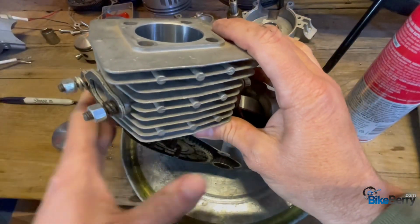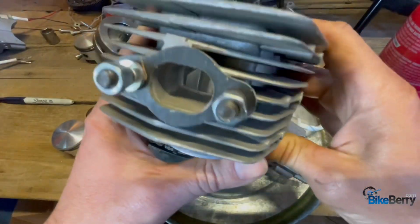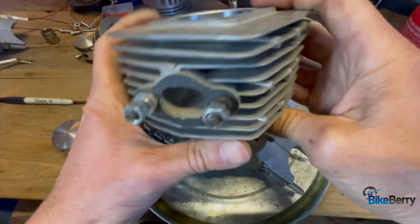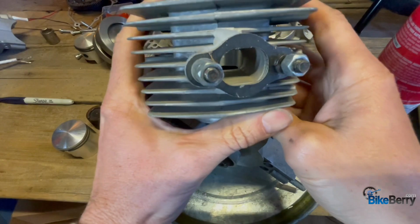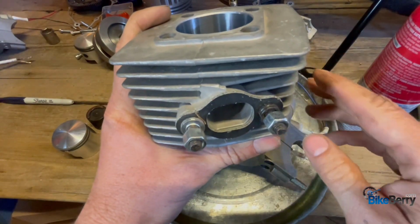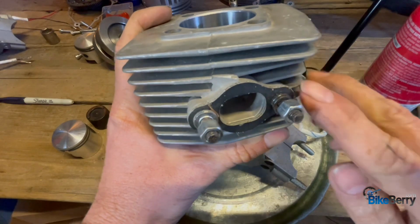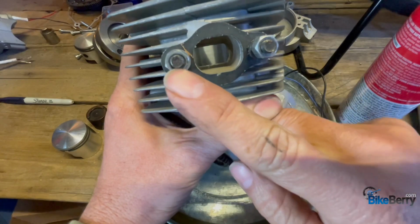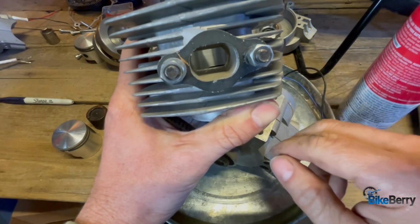When you're talking cylinder body, you want to make sure that you get the exact same one. Now, ours are the same, so we sell exactly the same thing, but when you ask yourself what is the correct cylinder body to replace mine, then you want to make sure and measure that it's 40 millimeter, because ours are all 40 millimeter. So you measure stud to stud should be 40 millimeters.